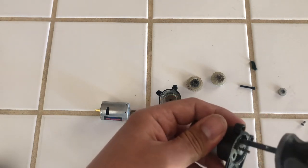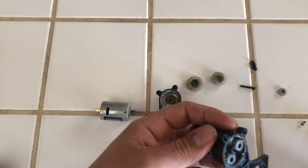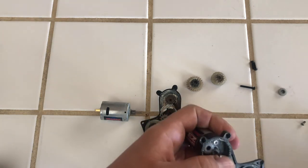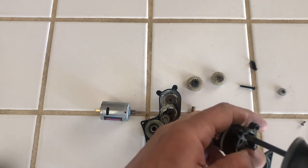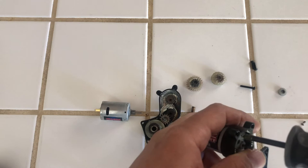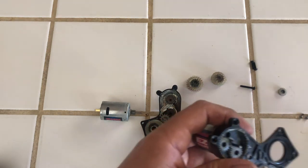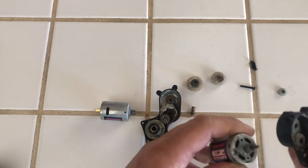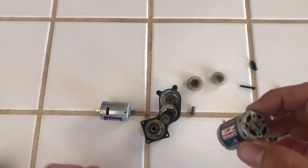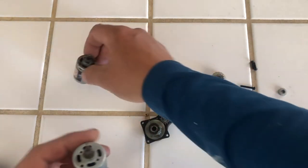And it's just that secondary screw. Get that gear out of the way. Too far. There we go. So if your easy start is clicking, it could be a bad connection, just false contact from the wand and the harness, or it could be that your motor's out. But here it is. So here's the old motor. And the new motor's already set, ready to go. I'm gonna go ahead and install this one.